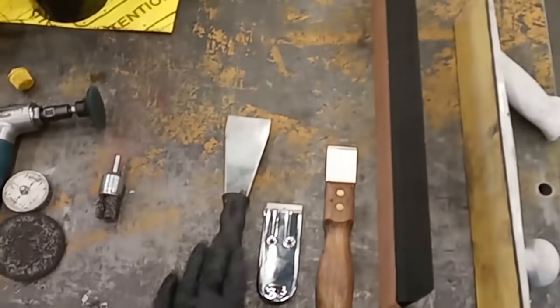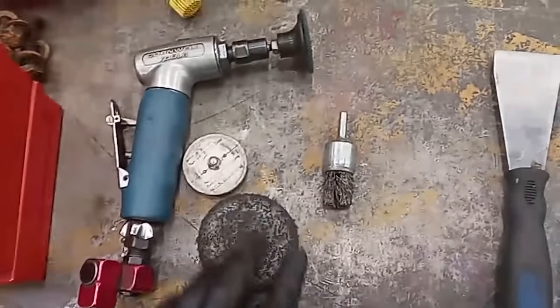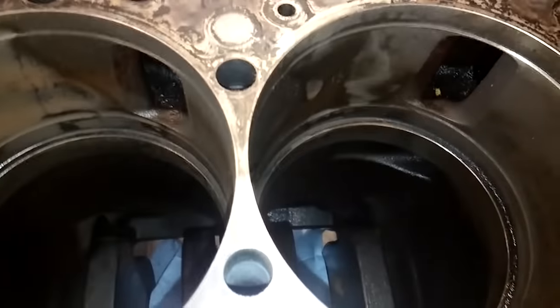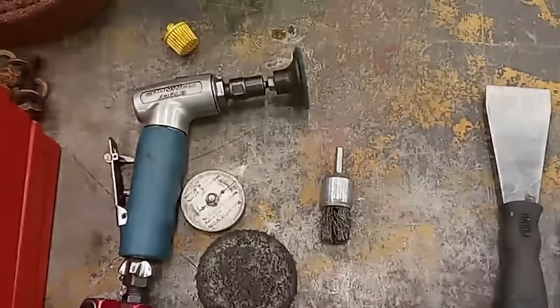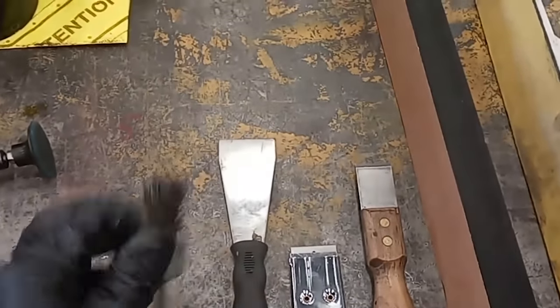These are the tools I use on the right, not necessarily on the left. We have scrapers and flat sanding blocks with sandpaper. I used to use this die grinder on the left with the roll lock wheels and the brush cups, but not anymore. This footage was taken about four years ago on another C-13 rebuild. You can see the roll lock wheel and pneumatic die grinder do a good job — at least it looks like they do — getting the gasket surface clean and shiny. But I've switched over to scraping and flat sanding. I sometimes still use wire brush cups, although I don't like them; I try to only use them on non-gasketed surfaces, mostly rusty areas.